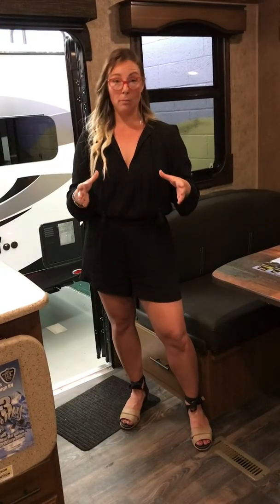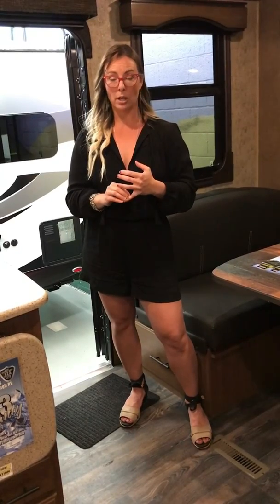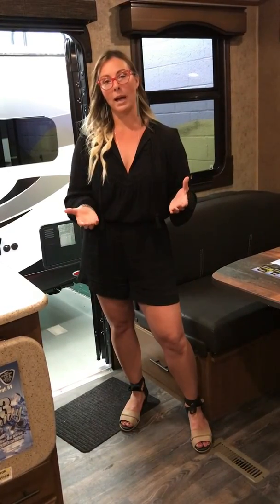It's just a small solar panel, basically for battery maintenance for when your unit is not being used. RV batteries really like a constant trickle charge. If you can keep it plugged in at your house, that's wonderful. If you have to store it somewhere else, or maybe it's at your house but you just don't have a way to plug it in, that's when this 10 watt panel comes in handy.